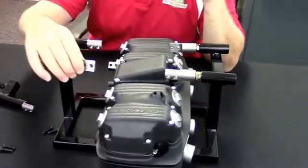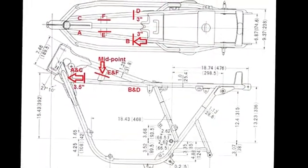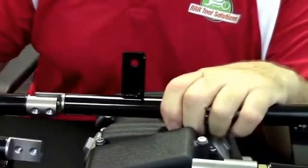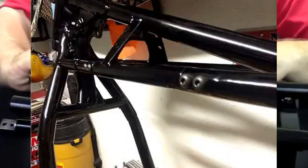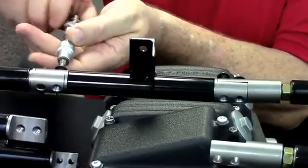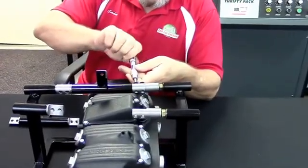We also simulated the welding end of the back joints. This is necessary so that these will stay fixed. We're going to put this all back together so that we can now have a rigid frame and replace the structural integrity. There are two bolts on each joint — again, grade 8 bolts. You can torque these down to 14 foot-pounds. I would encourage you to use a locking agent such as Loctite, medium strength — that's what I use.